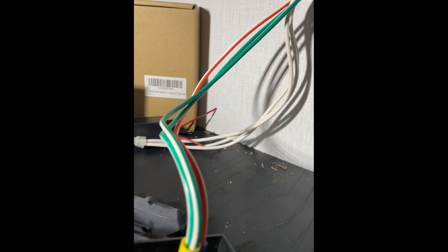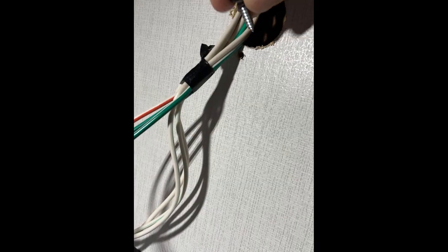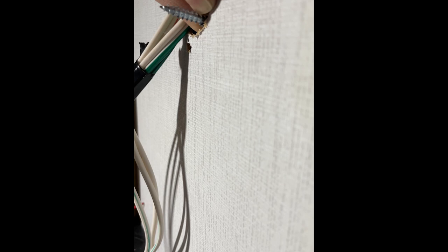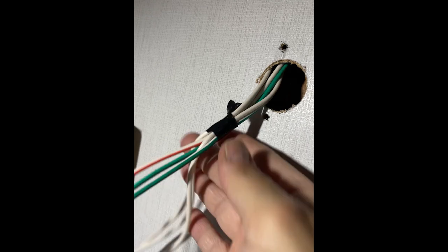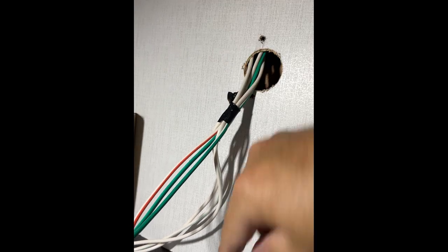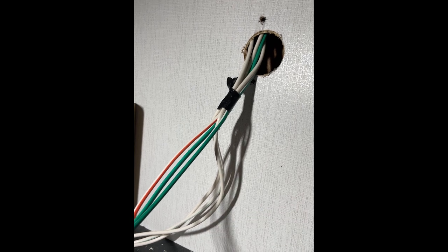From a safety standpoint, the screws that go through the switch go into this at-best eighth-inch-thick piece of paneling, and they are so long that you can see how much screw head sticks out. Behind this is a series of wires that run the USB and some lights and other stuff, so having that long screw poke through there is probably a recipe for a short and some blown fuses down the road as these wires jiggle and rub on the point of the screw head.